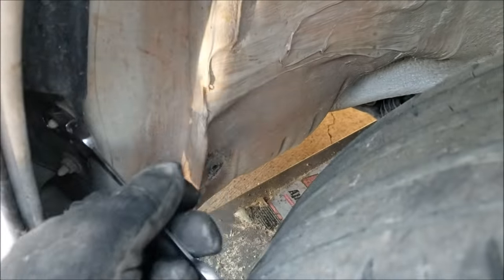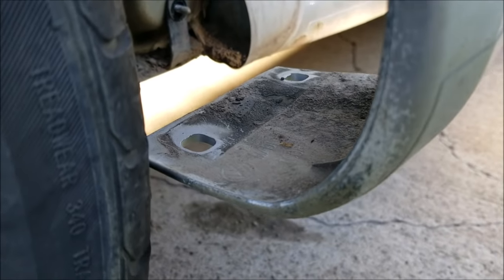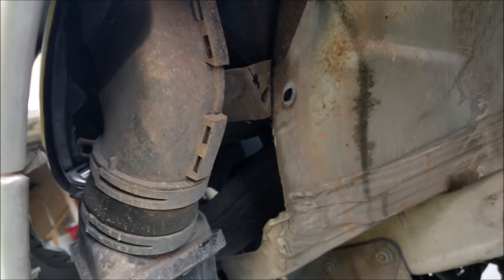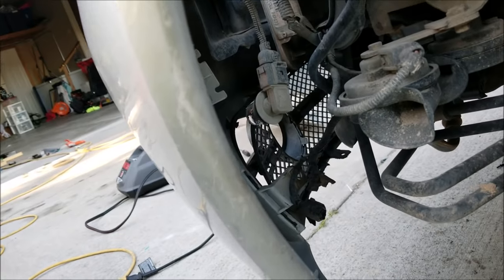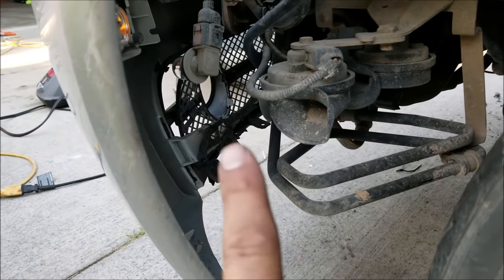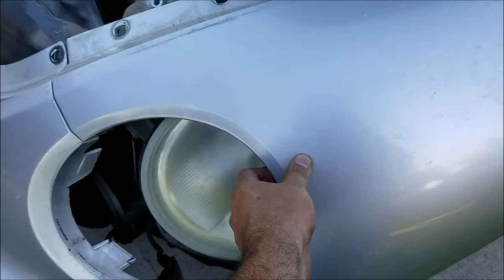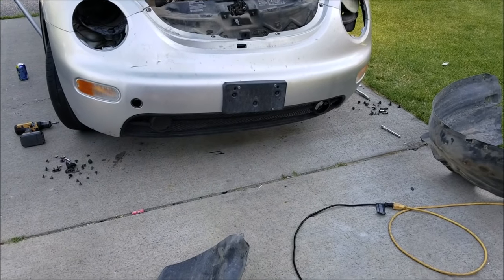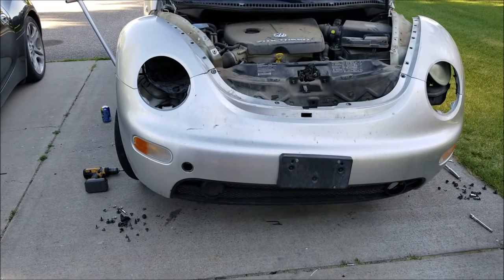They're tens — okay, here we go. On this side I did the exact same thing: I took all the 10mm bolts out. One thing I need to mention is down here on the bottom it has two of the T30s that you have to remember to take out, and then 10mm bolts all the way around. Then you've got to remember to do the two bumper supports. I undid this one because I couldn't get my socket up there because of the air intake. Undo the fender supports under your lights, blinkers. Looks like I got a fog light wire I need to clip. I couldn't get this headlight out — looks like it would have been broke before. The whole front shell is coming off already. I'm gonna grab some snips, clip that zip tie, and then undo the blinker on this side — and she's off just like that.